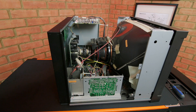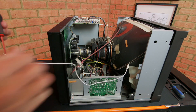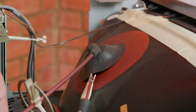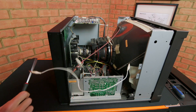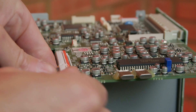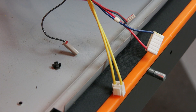The first hazard is the tube which can retain a high voltage even after the monitor has been unplugged. You need to short the EHT anode to ground, for example using a screwdriver and a lead connected to the metalwork on the outside of the tube. You'll hear a crack if there's been a discharge, but you don't get one every time. On this monitor all the connectors are different so you can't really get them in the wrong socket when reassembling, but it's worth making a note.